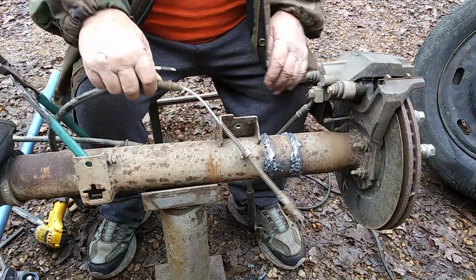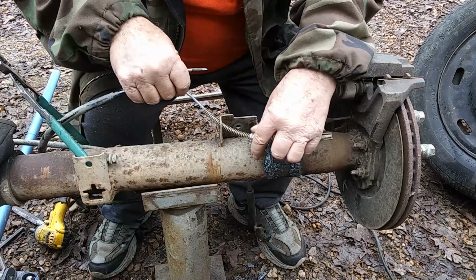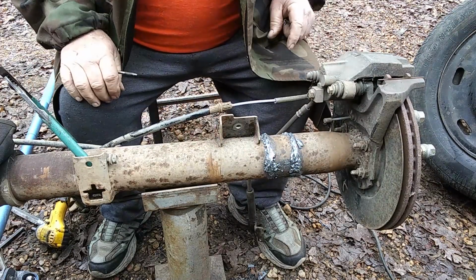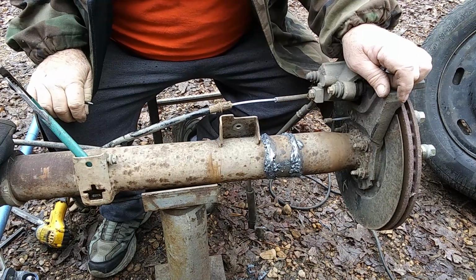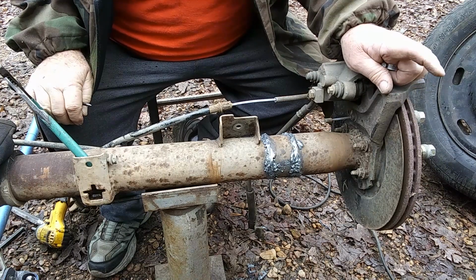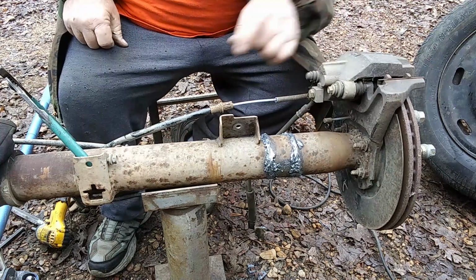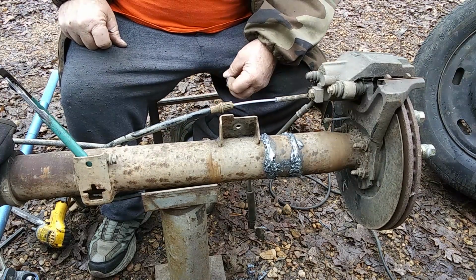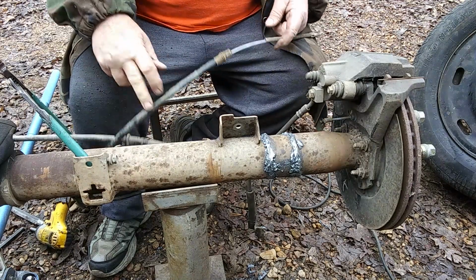And then that way you can take these off until you get cleaned up. Definitely, if you're planning on using the same rear end underneath your F100, to get your gear ratio right if you're using a 4.6 with an overdrive transmission, you're definitely going to have to use this rear end to keep the gears right on it. But it's best to go ahead and take this out.